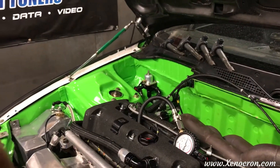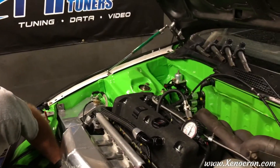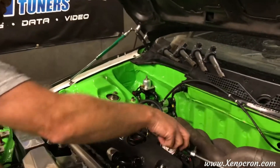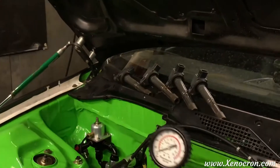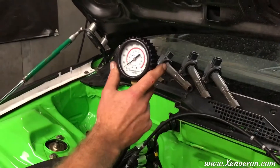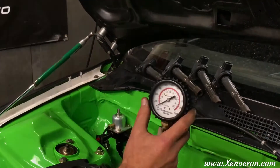You're also going to want to make sure that your car is on some sort of battery charger or tender. You want the battery to have the same voltage for every crank — you don't want to be wearing out the battery as you go from cylinder to cylinder and getting less power behind your cranks.